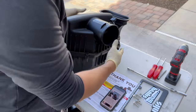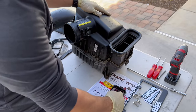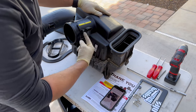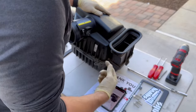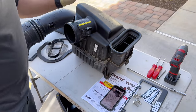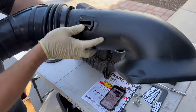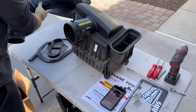That was super simple — just to get the factory intake off, just flowing through the instructions. Next up, we're going to take this mass airflow sensor off and then we will swap it to the Banks lid for the new location where the mass airflow sensor will go.